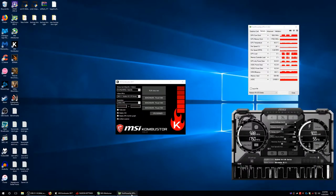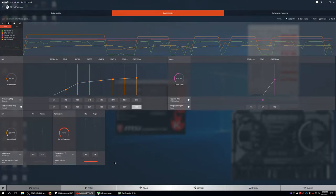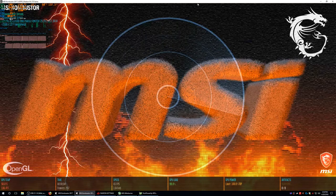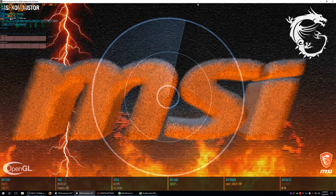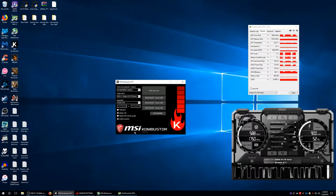This doesn't look like I'm getting any artifacts, so let's go even lower. I was able to get to 900 mV last time. Now I don't know if Wattman is going to let me go under 900. I guess because I have the new stock BIOS, he might actually let me go under 900 now. Before the old BIOS was limiting that.